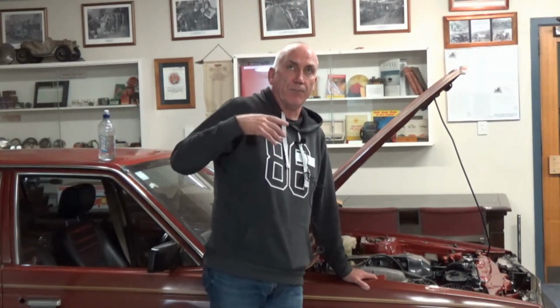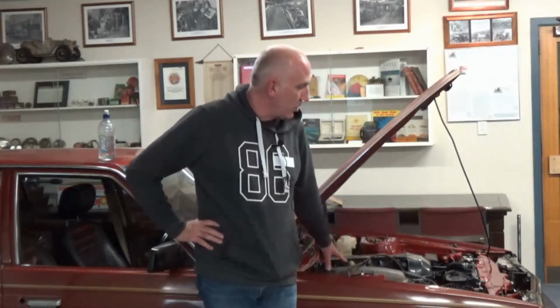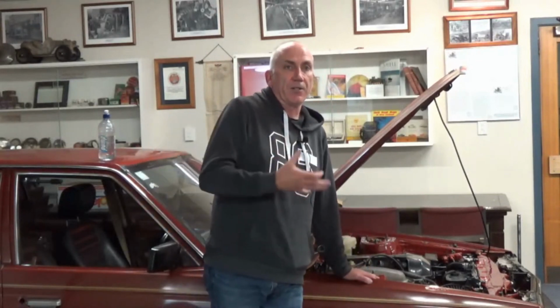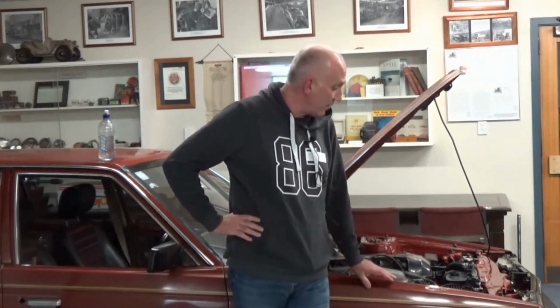When I did my V8 Celica, which is rotting in the shed project, which again is the same body shell, that's got custom front struts, which are based on Nissan S14, where I cut the stub axle down to just a wee tube on the Supra strut, put all the Nissan bits onto it, and it's fully adjustable. But I didn't want to go that far with this. So my goal is to have in effect a standard strut, aftermarket spring, aftermarket shock, nothing overly fancy, and just a camber plate to correct the camber in it. I've had it aligned, and it's all right.